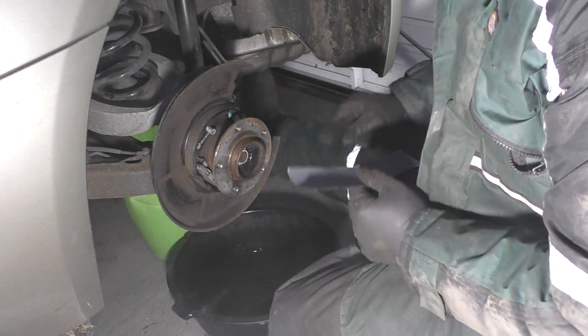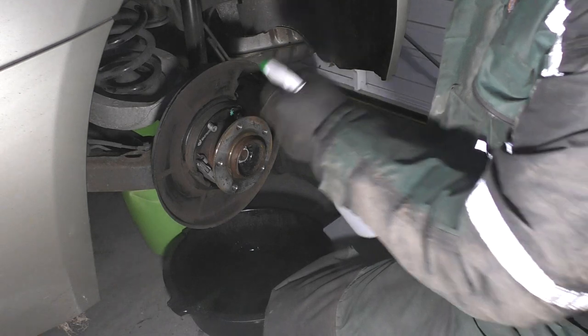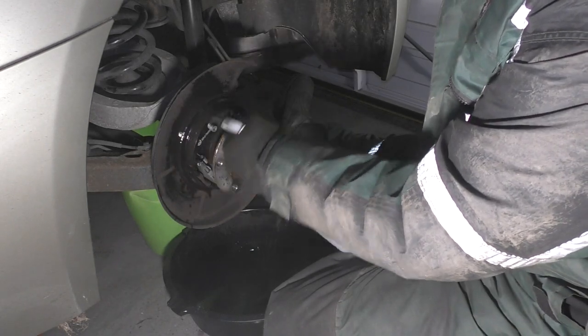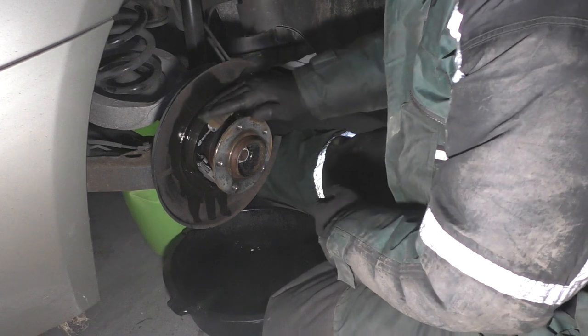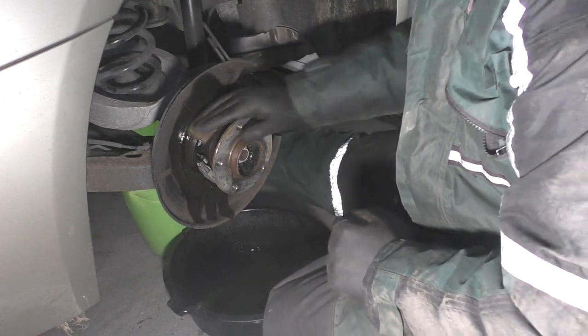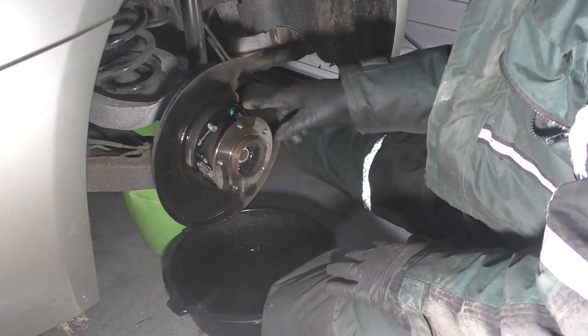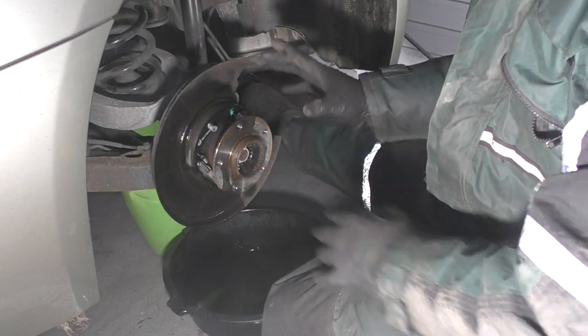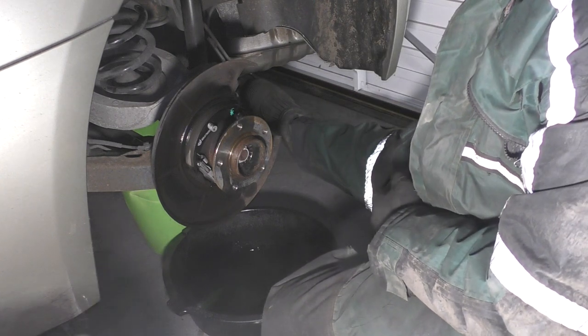So it's a lot colder today, but I've been to the shops. I've got some brake cleaner. I'm just going to squirt all this up with brake cleaner, and hopefully clean up these pads, or these shoes, as best as possible. Now that the shoes are all cleaned up, I'm going to let that dry, and it pretty much absorbs into the air within a matter of seconds.